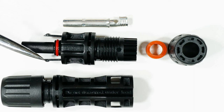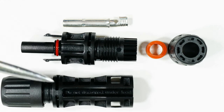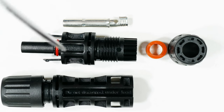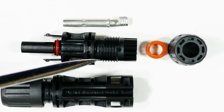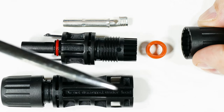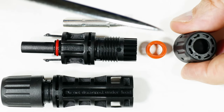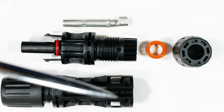These two ears will secure it to the next plug — they go in here and here and lock it in place. Moving down there's a little ear sticking out here, and that little ear is going to engage in these notches on the screw cap. What that does is it helps the screw cap not unscrew itself over time so it will stay in place as it should.